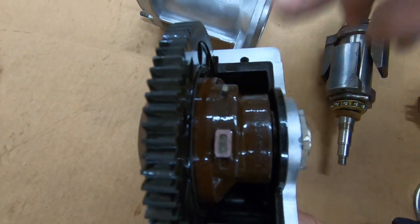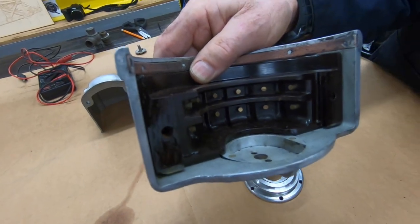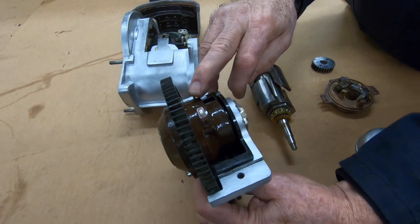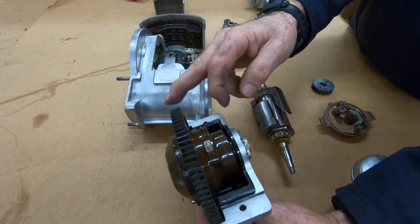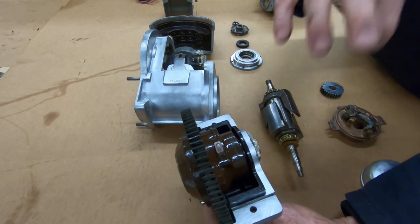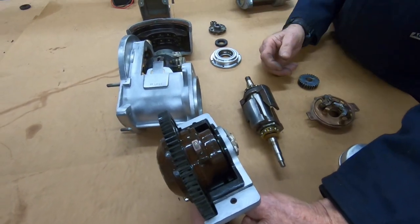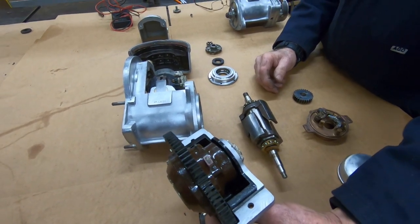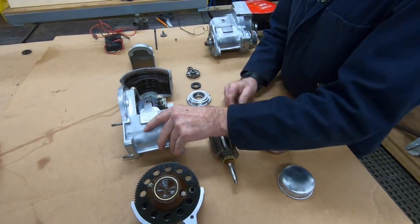It runs through this little carbon piling right here and then distributes out to the points here where it picks up on the rotor cap. Every time the rotor goes by one of the pins in the rotor cap, that's when it takes the spark out to the plug. This one is the coil, and this one is the shower of sparks — it follows the initial ignition point by seven degrees, providing a continuous shower of sparks to get the fuel going when it's cold. That's a starting system.